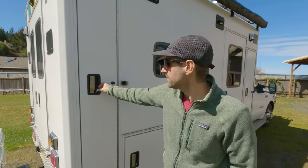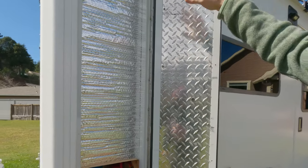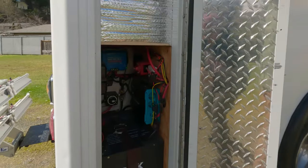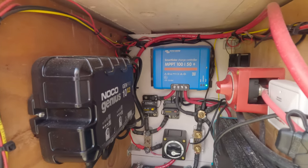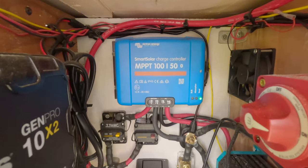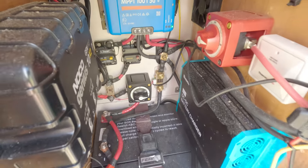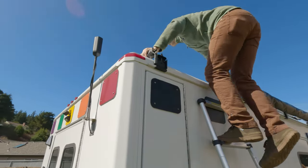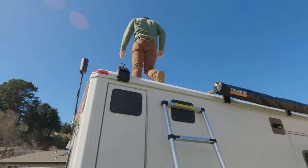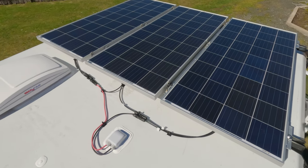This one here is my electric cabinet. It used to be full size but I took a bunch out for the interior. I've got 400 amp hours of lithium iron phosphate batteries, a DC-to-DC charger, shore power charger, 50-amp solar charge controller, and 500 watts of solar power. For solar I actually went with 540 watts — my calculated usage was about 200 watts, but I live in the Pacific Northwest, so I just went ahead and doubled it and then added some.